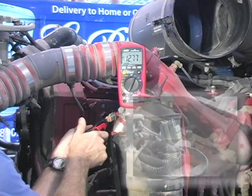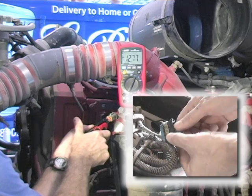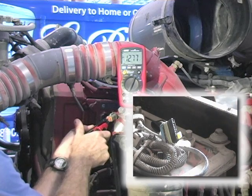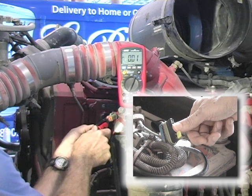The reading that really makes you money is when the voltage drops, and LoadPro makes them insanely simple. Watch this. We'll remove the fuse from the ECM circuit and instead use this guy's thumb to complete the circuit. You still read 12 volts. But don't let this confuse you. Push the LoadPro button now and watch the voltage drop, just like I promised.